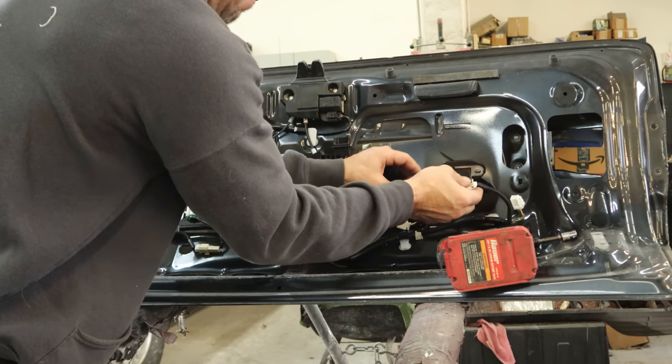Of course that convenience comes with a price — they're not cheap, I will warn you in advance. Now that our bolts are out of there, we're going to run a tap in there just to clean up the threads and get all the rust out. Tap on the other side. Then we'll run some bolts in there just to make sure our tap worked, and we'll leave it for the painting gnome to put all fresh paint in there so that we still can't get our bolt in when we're done.